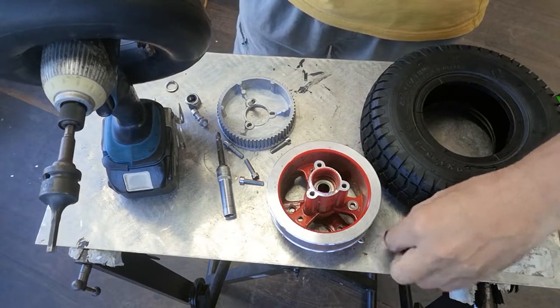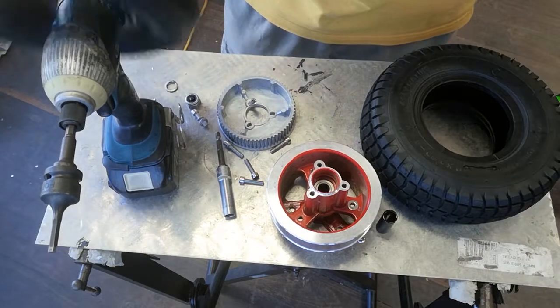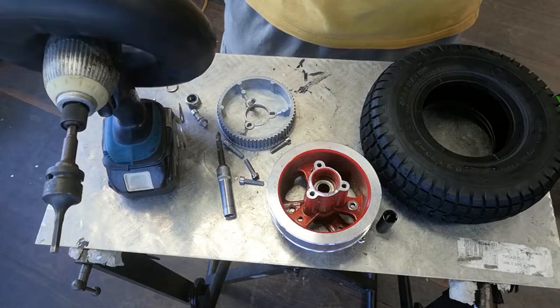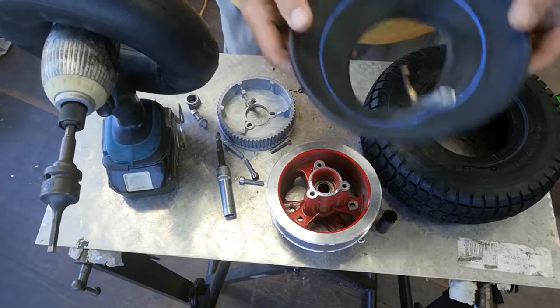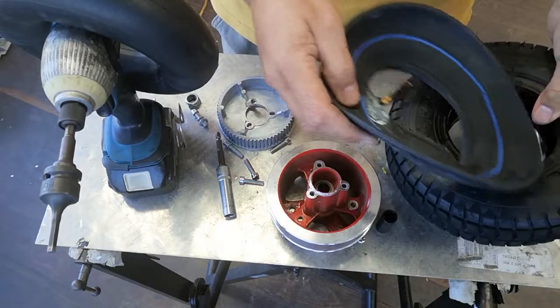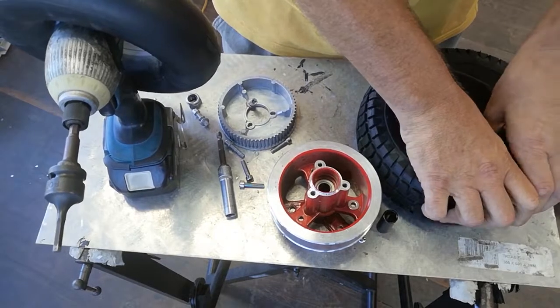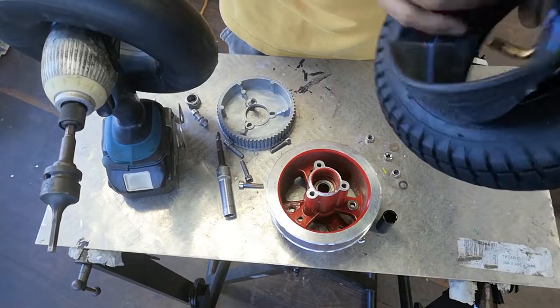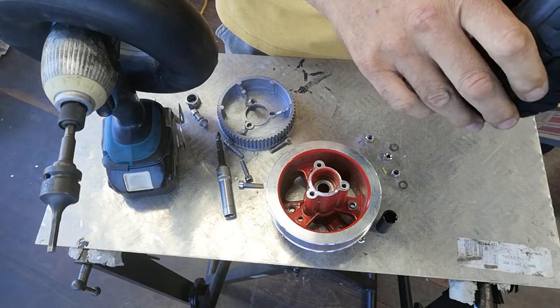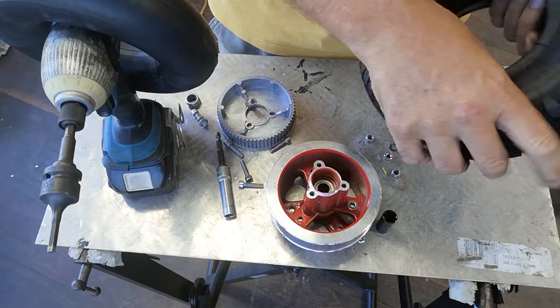At this stage you've got the choice: if you need a new tyre, you just transfer the tube that's just come out into a new tyre. Because of a flat tube, I'm just going to replace the tube in this situation. What we need is to put a new tube inside the tyre, which is just a matter of squeezing it and working it into the gaps until it's all in position.